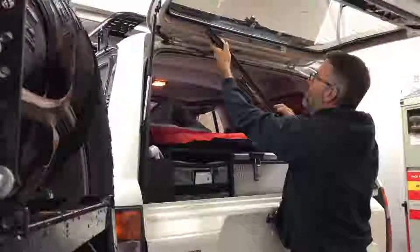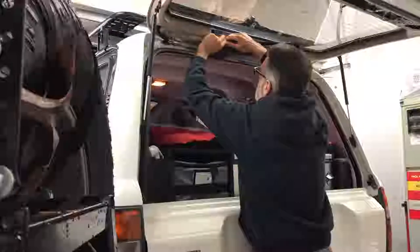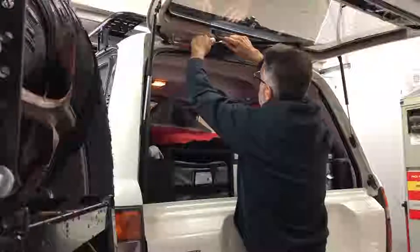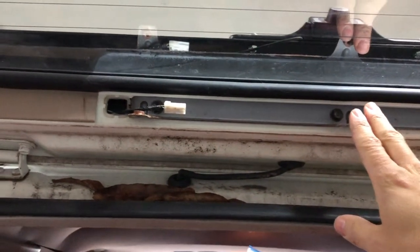And it's got a connector right here. You push in on the center tab. Sometimes they're a pain. This one's going to be a pain. I'm going to grab a screwdriver. So we're going to go in between the middle tab and the housing and just pry down slightly and pull it to the side, and it's off. Because this is a roped-in style seal on the rear glass, I'm actually going to take this metal bracket off as well. And those appear to be 10 millimeter hex head bolts.